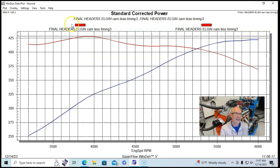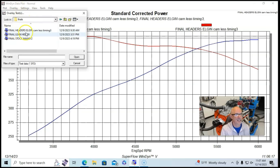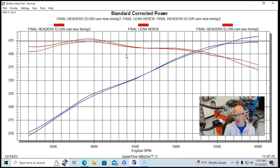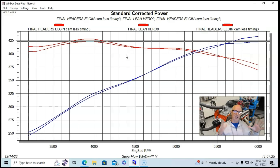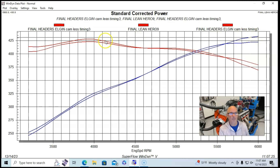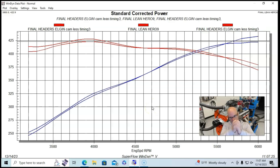There's more to the story because we actually did a little more tuning — kind of a hero run where it was maybe leaner than we'd want it to be. We leaned it out to about 13.1 or 13.2, and you can see it actually had a negative effect on low-speed power because we just did this with jetting. But it made quite a bit more power — 434 horsepower — though peak torque dropped to 423 foot-pounds.